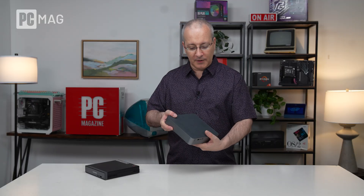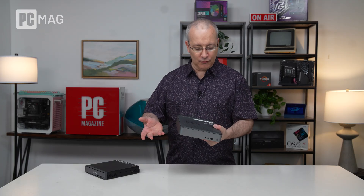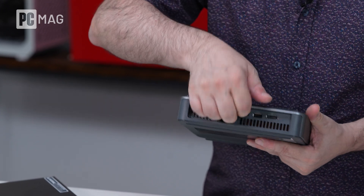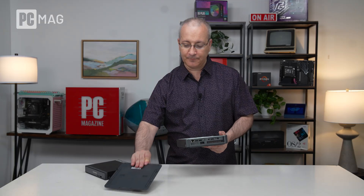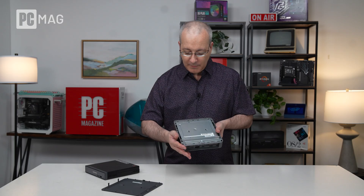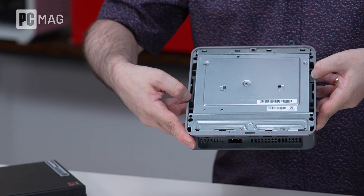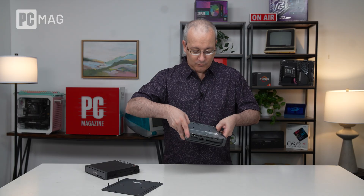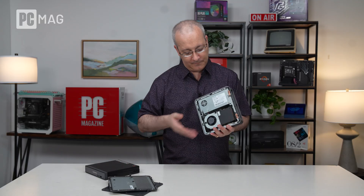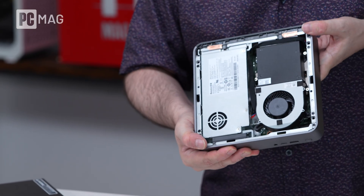This one took a little figuring out to open. You don't see any levers, buttons, or screws anywhere on it. But at the back where the ports are, there's a tiny button that pops open the top — which doesn't look like it gives you a whole lot of access, just a big sheet of metal. After poking around for a few minutes, we noticed two things on the sides that look almost like wireless keyboard dongles. Press them, and the bottom pops open.